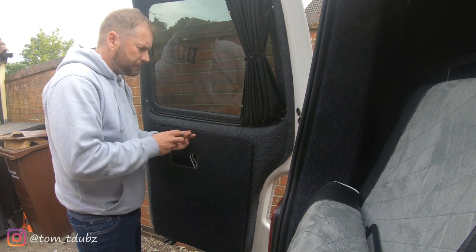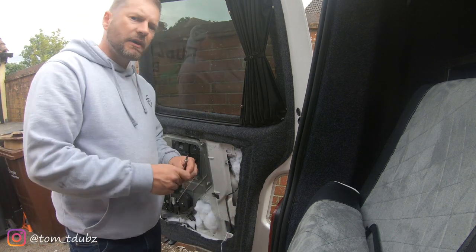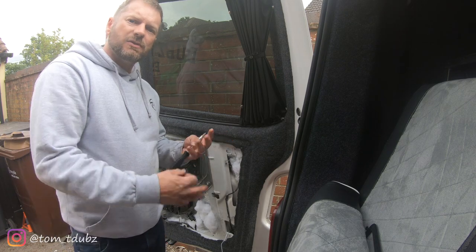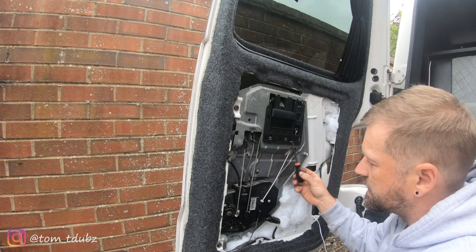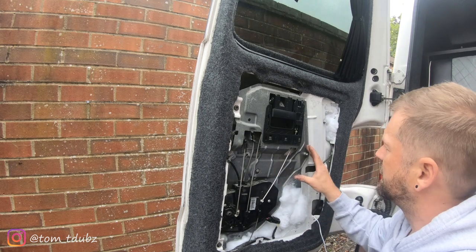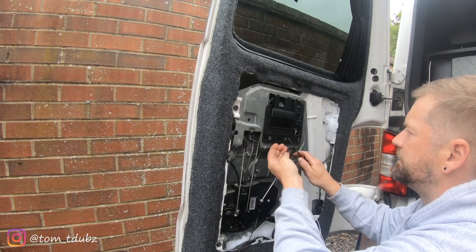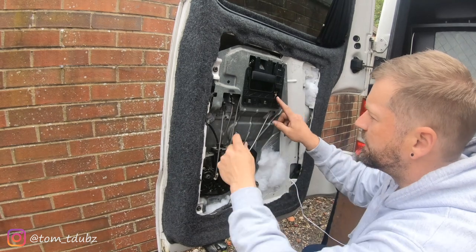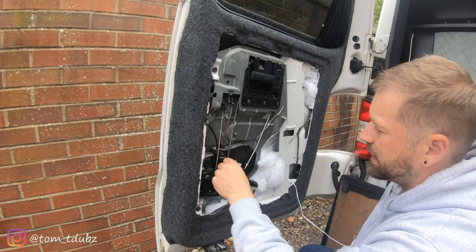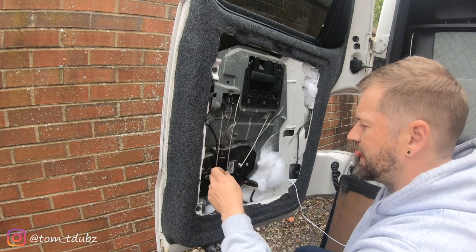You've got to get rid of your door trim panel — take it off however you've attached it, with pegs, pins, or screws. I've got screws in mine because it was only a temporary fit. I'm going to be relining my whole van at some stage with a lighter gray. When you get to this stage you're going to want to remove this panel because there are spline bolts behind it. These two metal parts come off first — this one just pops out, and the third one along on the bottom also just pops off. Do it gently so you don't break the little plastic clips.